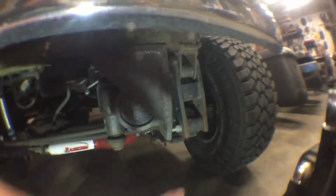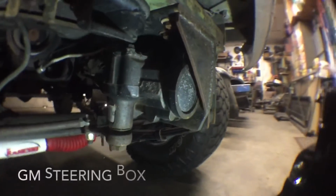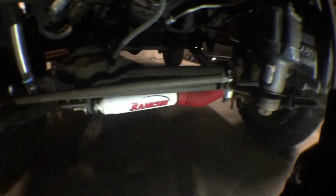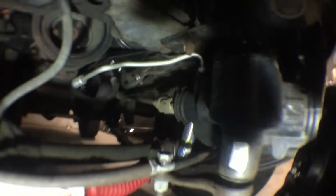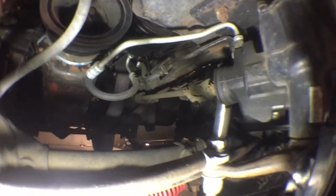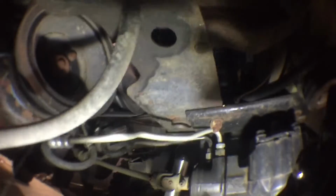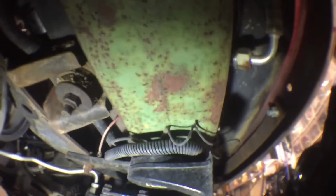So that's half inch angle iron, big gusset in there that I made. And it's all bolted up to the frame there. There's a cross member there it's bolted to. And it's a drag link setup. So if you can see, the shaft runs up there to the bearing and then up to the steering column. And it all works out really well. You can see that it's bolted to both cross members here. So somebody added this later, obviously.